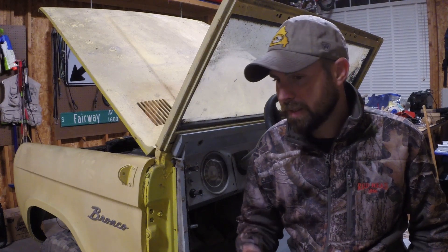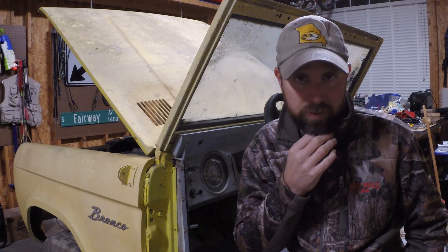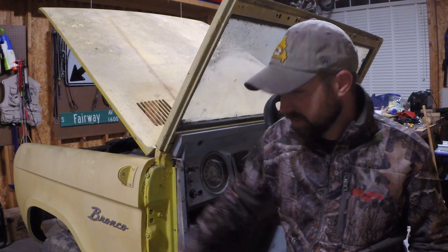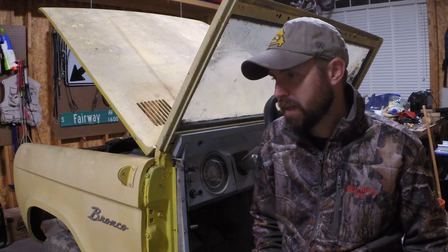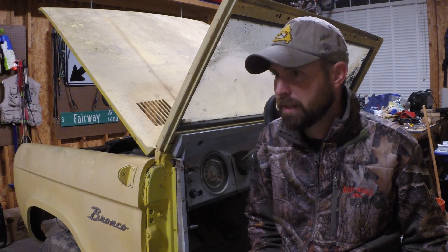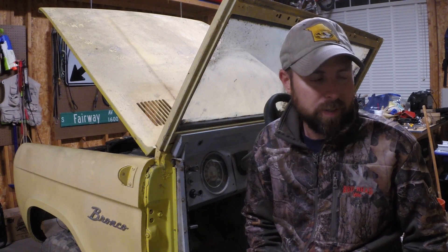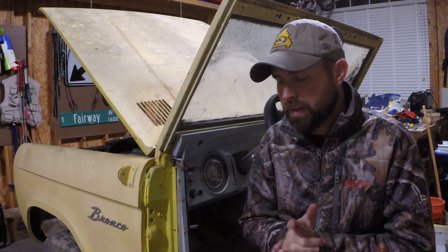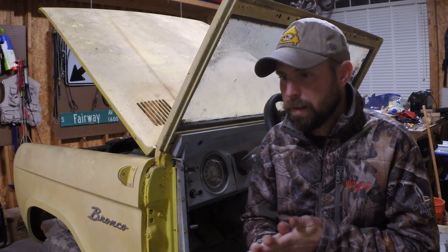I have a lot of questions about how sandblasting is going to work. I don't have a rotisserie. I've talked to a couple of sandblasters and one said they could handle the body if I delivered it — good news since I want the underside and wheel wells blasted too. The plan is to blast it, get it into primer right away, then the clock can slow down. With the frame, I'm going to replace the fuel lines, brake lines, and all the wiring.